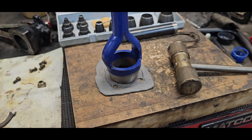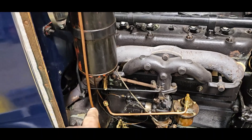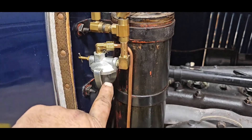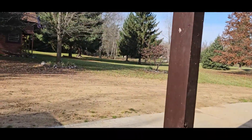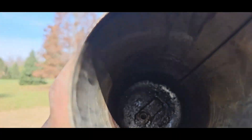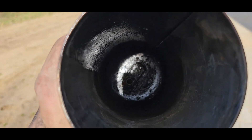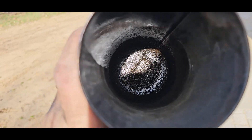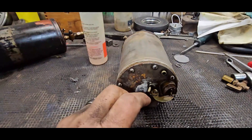Lucky I didn't take that out on the road - it just did it again. I have absolutely no fuel coming out of the fuel pump. I've got fuel on this side, so it's got to be in the fuel pump. I had to do it - I pulled the can off. I'm just getting junk everywhere. Yeah, it's pretty rusted up inside of there. The chunks of rust could be getting into that line area.